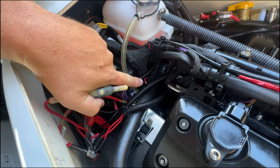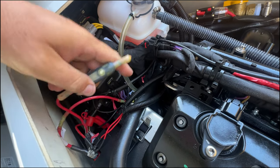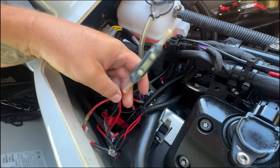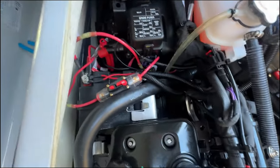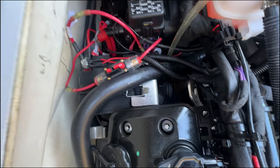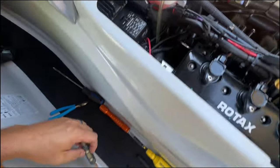Here's what I did: I cut the wire above the fusible link, so now that goes to the wiring harness, and I pulled this from down below. I'm going to cut here, put the circuit breaker in, and we should be good. Here she is, all installed — accessible. Now I have no more fusible links, just a little bit safer.